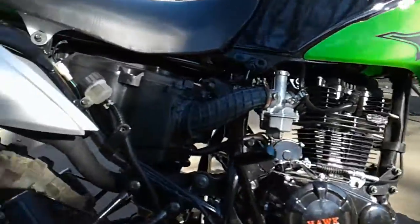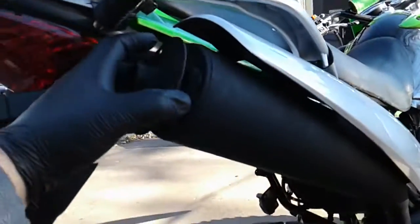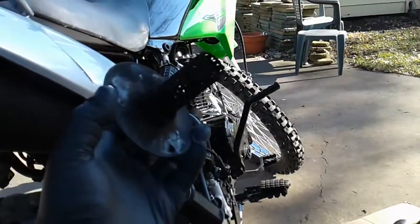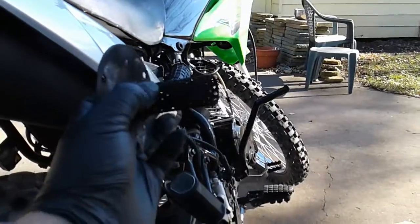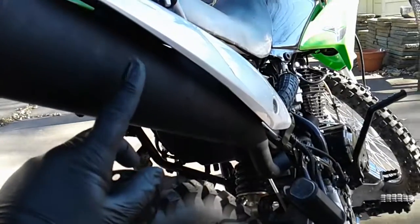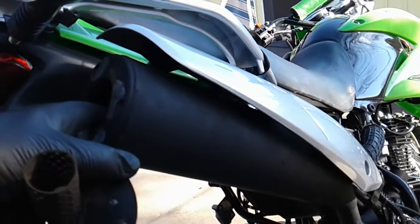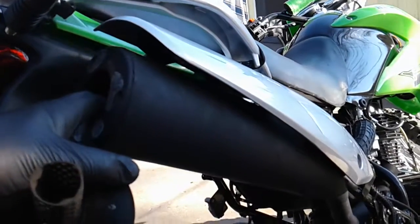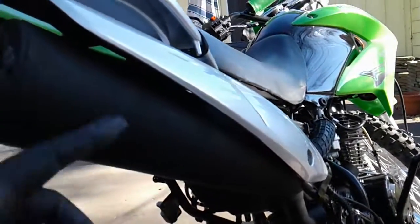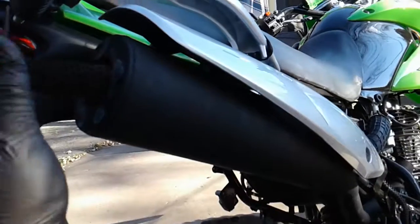I'm not sure I like the look of the wrap. Shout out to DJ Eric for giving me the idea to cut off the cap — free-flowing now. As far as that first baffle inside, all I did was put in about a dozen or so large screwdriver holes. I sharpened up an old screwdriver and pounded it in — pretty easy. I didn't want to take the whole disc out; there's a disc in there with a little hole and I left that intact.